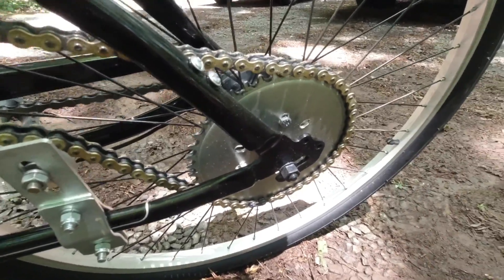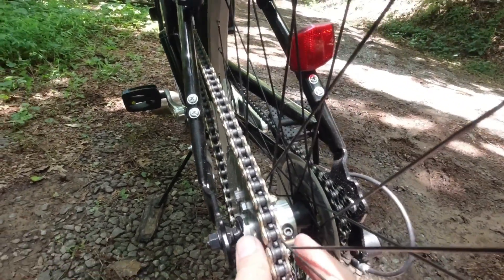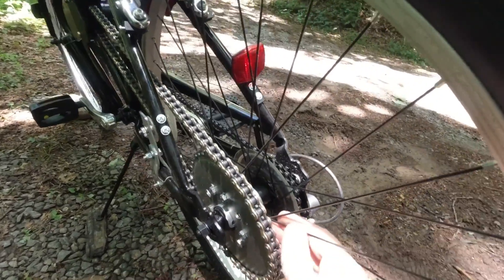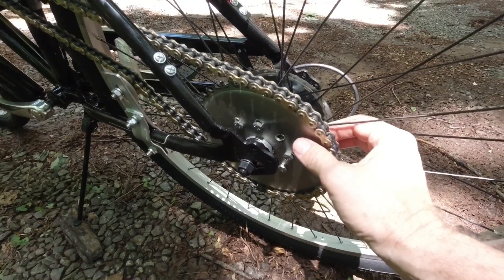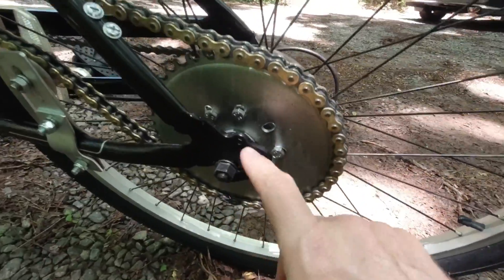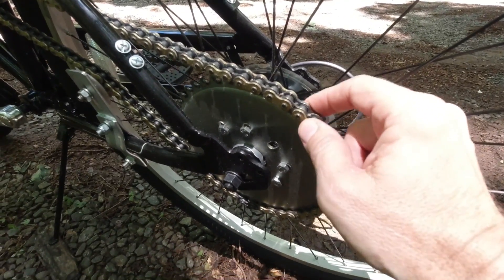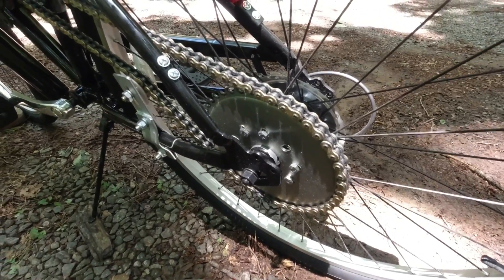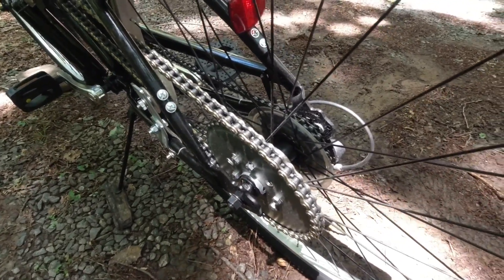It's easy to size the chain once you have the right tool. Now the most difficult part of the assembly — they'll tell you right off — is putting on the sprocket. It comes with a rag joint: a little bracket that goes on the spokes and squeezes the sprocket on, held by tension. When you see it you think it's not a great setup, but they actually hold up well — people go over 40 miles an hour with upgrades and that rag joint, and it lasts. However, it's extremely aggravating and time-consuming because you need to get it perfectly centered, with no wobble. The more time you spend on this, the less vibration you'll get at speed.